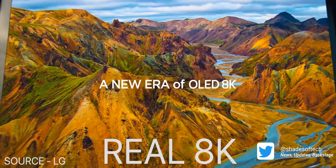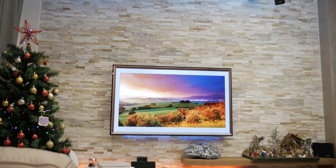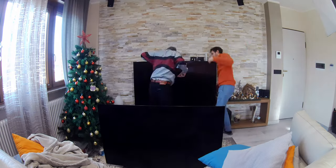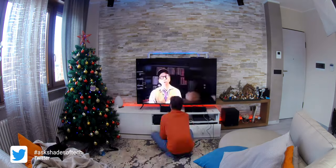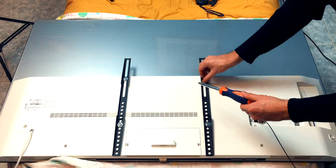So I had mainly three big problems with this TV so far. I had the LG OLED C9 wall mounted for about one month and was going to unmount it to mount this 8K TV. I wanted to test the wall mounted system and then I realized it uses a really wide 400x400 VESA instead of the standard 300 VESA that most other TVs have. More importantly, the VESA standard was placed in the upper part of the TV, not in the center or bottom — a really strange engineering decision.